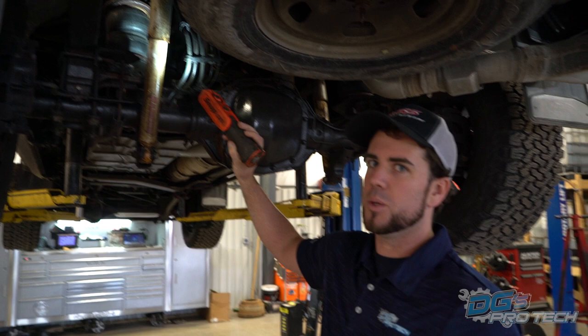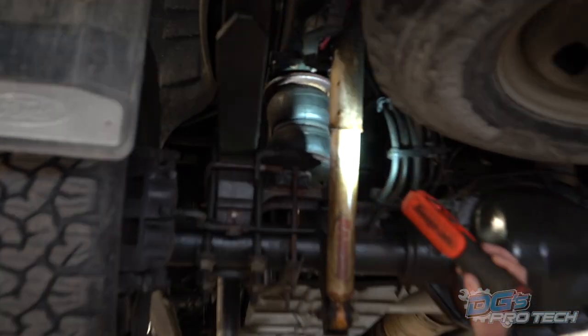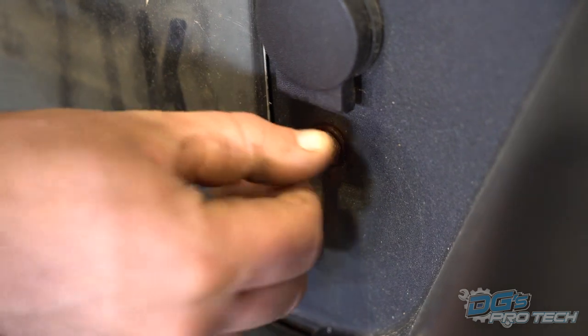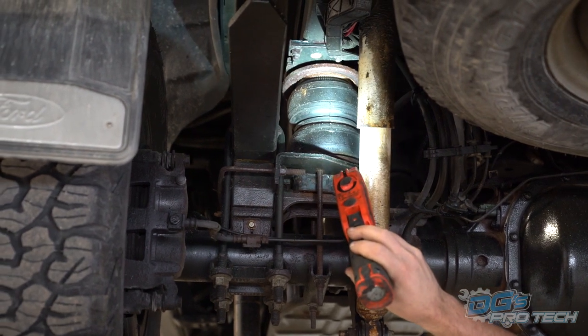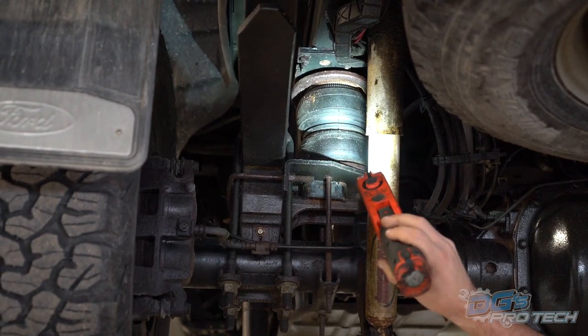Airlift offers a lifetime warranty - the beauty is having it installed by an Airlift dealer like ourselves. If that bag ruptures due to normal use, we'll mail you a new bag or you'll come in and we'll install the new bag. There are some limitations, so see us as your dealer for direct information, but typically you're covered. This bag system has a Schrader valve - I typically move it up into the gas door area or the bumper area depending on the application. You can see the leaf spring design in this truck, the bracketry is custom for the application, and it sits right in the factory bump stop location. Pump it up for more spring, air it down for less.